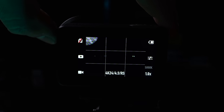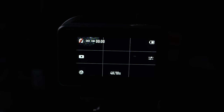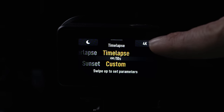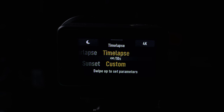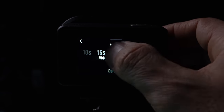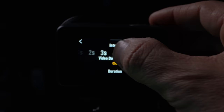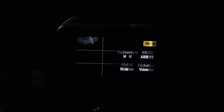Next we're going to do the DJI Osmo Action 4. Get to time-lapse mode, click down at the bottom, and make sure you select time-lapse and custom, then make sure 4K is selected up top — 4K is the highest resolution available and custom gives you full control over the parameters. For the interval you can go as fast as 0.5 seconds up to 40 seconds; I recommend 2 seconds as long as you have plenty of micro SD card space, or 5 seconds if you're worried about space. Set duration to infinity for precise control over start and stop.